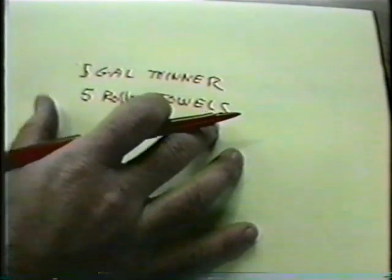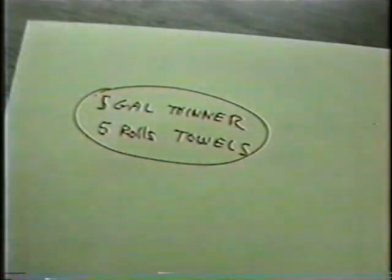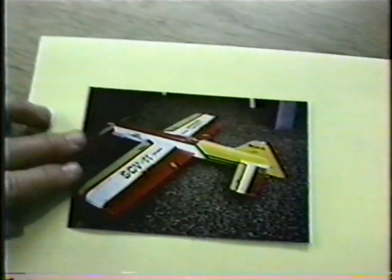What happens is, because the finish was soft from all the retarder, it was soft like Jell-O, and you could just take a razor and scrape it right off. But the cost was this: I'm sure his hands turned to alligator skin, but because he wound up salvaging the airplane, it was worth it. I don't think this is the airplane, in fact it was another one, but what he wound up with is a really nice looking plane instead of a mess.